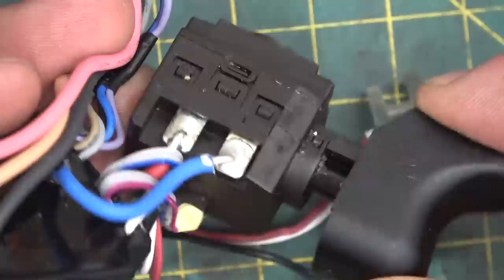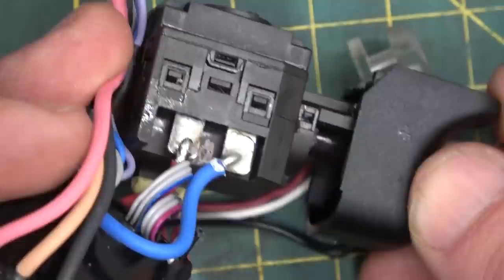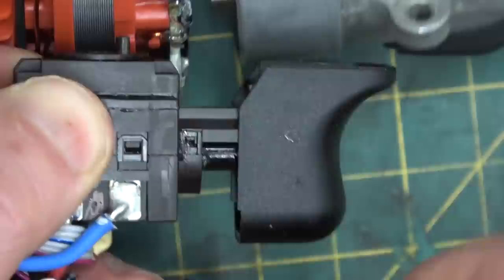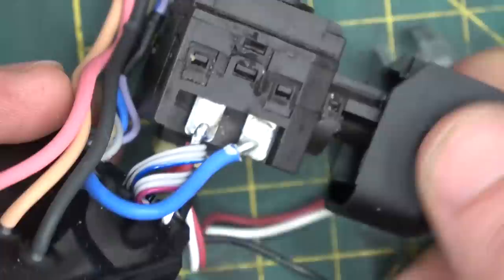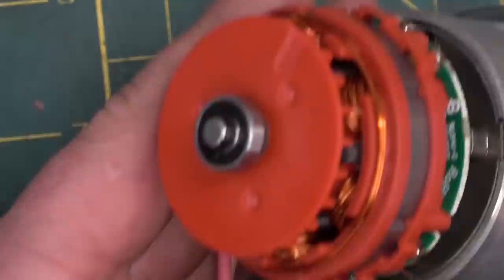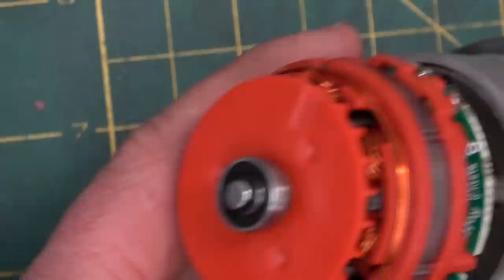The switch itself — we got some data on it: Chinese brand with a French name. They've gone away from that ubiquitous iron-oxide red color. And look at the plunger — they've added some rails in order to keep it compact. You cannot do that with a regular switch that just has a regular plunger, because it'll twist right off. And this is making and breaking full battery voltage but also sending out an analog signal to tell you what speed it wants to be run at.